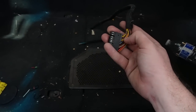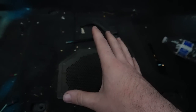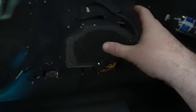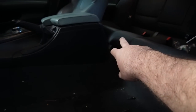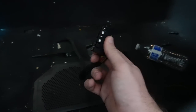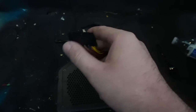So that one wire for the seat emblem — we need to get another wire from the car connected to it so it gives power to the seat emblem when the interior lights turn on. Basically, any of the interior car lights that come on when you open the doors — on an E92 there's a light right in the back that's much easier to tap into. We're going to tap into one of those, run a wire, and connect it into our seat harness for that lighting effect.